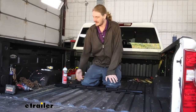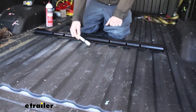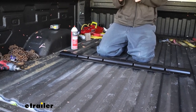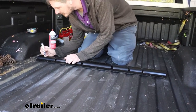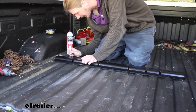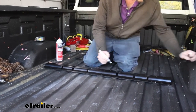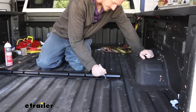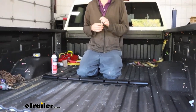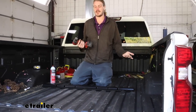Once you've got it marked and laid out, we can go ahead and mark the holes we're going to be drilling. I went ahead and marked them here on the rail — we're going to be doing the center hole towards the rear of the truck, and then the third square slot on each side. Those are the ones we'll be drilling. I like to mark them because it's a little bit easier to see when drilling since the black spray-in bed liner makes it kind of hard to see. Before we go to the full size we're drilling out to, we're going to start with an eighth inch drill bit just to do small pilot holes, so we can verify they're going to properly line up with our rails. If something's not quite right with a small hole, you could easily fill that in with some silicone and never even know you made a mistake.